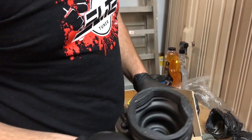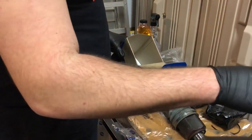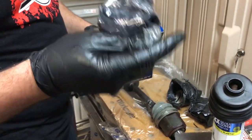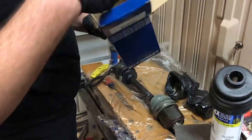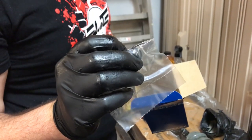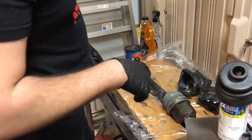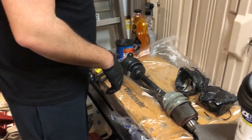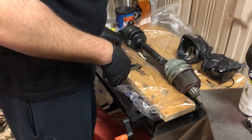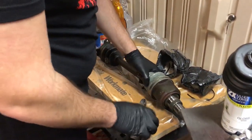For the LSD, this is the inner - it's a fresh boot I'm going to use - and a big pack of grease, and then a snap ring that I can use to reassemble the CV joint. So basically the first step I'm going to do is remove the boots from the axle completely, and then I'll show you guys how I go about breaking it all down.